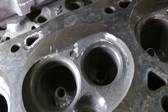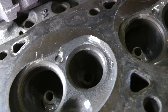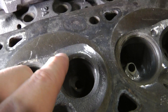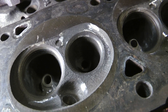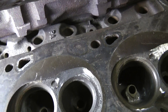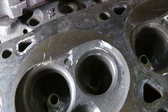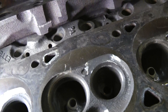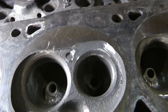That helps to scavenge and break that ridge a little bit better. But what it's also doing is giving you about a three percent increase in horsepower. So on a build like this, that little cut right there could be good for about 11 to 12 horsepower — and obviously torque as well, just increasing the overall exhaust velocity. I didn't have a figure before, so I didn't want to say 5 or 10 horsepower and have that be way off.